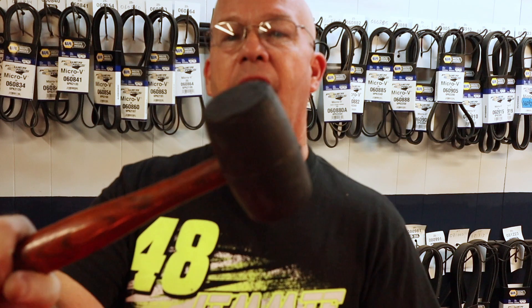Another thing you're going to need — I didn't put this in the first video because most people have a hammer laying around. But once you're tired of borrowing tools and you've got all your impact sockets, extensions, and ratchets from part one, in part two you're going to need hammers. You're putting hubcaps back on cars — you don't want to smash them with your hands because you end up with bone chips and arthritis. So you want a rubber mallet for putting on hubcaps, knocking a wheel loose if it's stuck, or anything you want to smack without damaging. Maybe you need to get an alternator out of a bracket that's jammed — you can hit it with a rubber mallet to free it up.